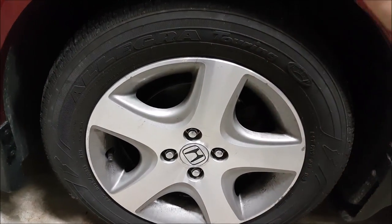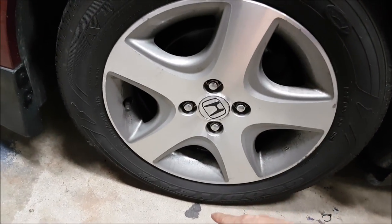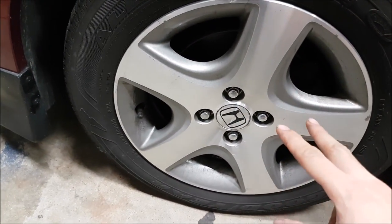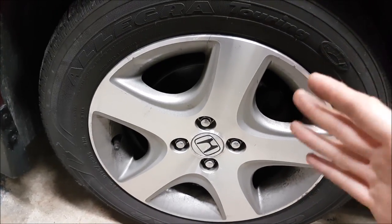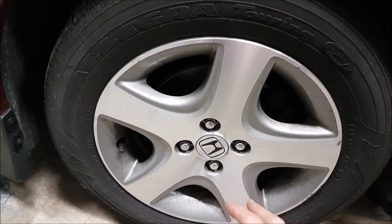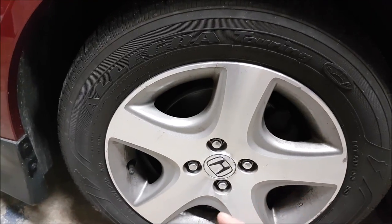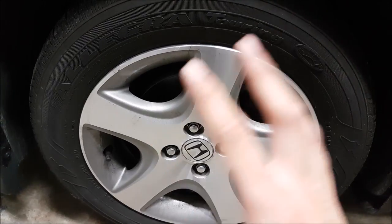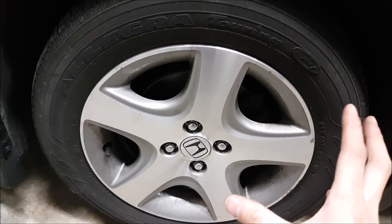Let's not forget the most important safety feature in your vehicles — it's your tires. It is the only thing that touches the road. We run two sets to optimize traction because we have quite a range of conditions where we live. Our winters go roughly between zero degrees Celsius down to maybe minus 15, and summers range anywhere between 20 up to 35 degrees on a really hot day. Understanding your temperature and driving conditions lets you buy the appropriate tires.